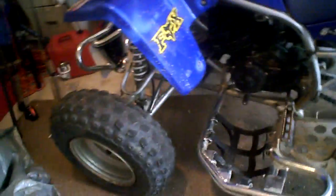What the throttle override system does is basically nothing. It's supposed to, if your throttle cable gets stuck open while you're driving and the throttle returns to neutral position, cut off the spark and bog your engine. The throttle override system causes more problems than it does any good. So if you have an '03 and lower, what you do is go inside there and disconnect the actual TORS unit, or the brain as some people call it. That's pretty much all you have to do.